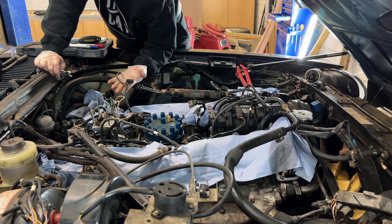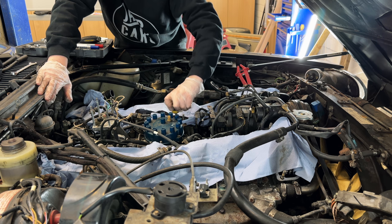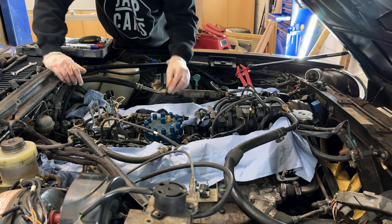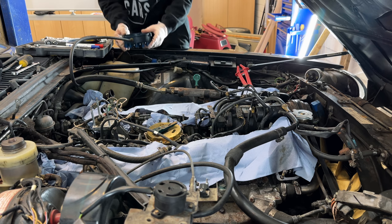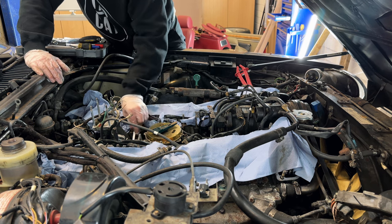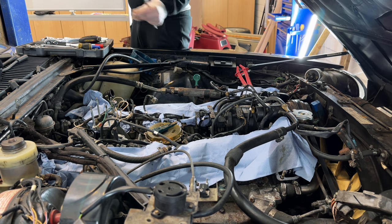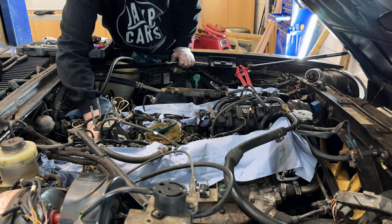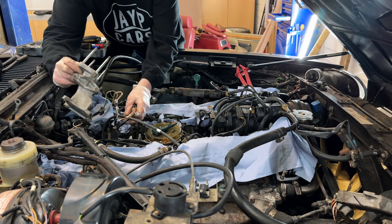This one will come right out below bank A. That goes to the ignition amplifier - that's got the blue and red lines in there. Then this piece will go over the top of bank B. I've removed the cap - there are little screws either side with a little washer. Second screw out, and there's a third one around there. I've got a bit more room now taking that cap out. This is the bolt on the left of the pedestal. That bolt's out with the washer - this one has two washers, the little one and a big one, and then the one around the back. The pedestal should be loose now - removing the final bolt in the back corner - this should lift up and out without any issues.